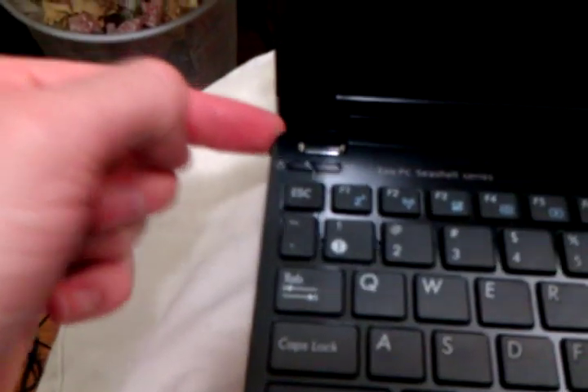You want to remove those, then take a little flat screwdriver and shove it into this tiny little hole in here. There's a little tab — push that in, and another one on the other side. Before that, push these tabs along here, then jam these two end pieces in here — they're just two little tabs. When you do that, the keyboard is going to start popping up, and you can see it's already starting to get loose.